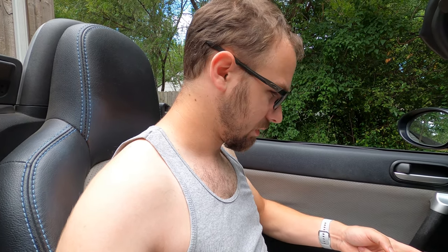babiesfirsttune.bin onto ROM drop, and boom, it's only having to write 256 blocks instead of the like 980 or something that a full ROM would be. So that's pretty cool. And that also saves wear and tear read-write cycles on the ECU itself. And I just heard a whole bunch of relays and stuff click. So I'm gonna go quit.